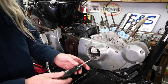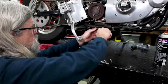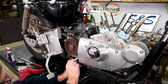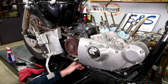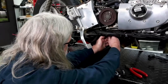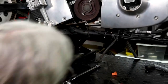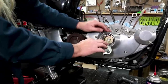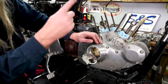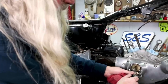Two pillar bolts out, and we're going to have to find the plug for the ignition. By wiggling the wire down here, I can see this is the pickup, and here is the plug for the pickup on the frame — we'll go ahead and unplug that. The next thing we're going to need to take off is this cup that has the two little windows that goes through there and tells it when to spark. This cup is attached to the end of one of the cams.